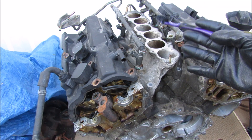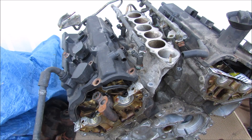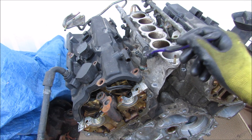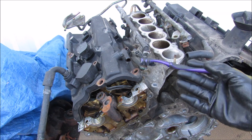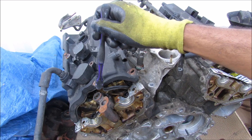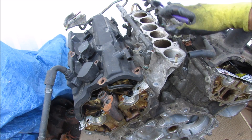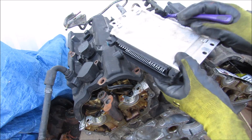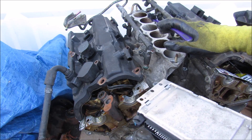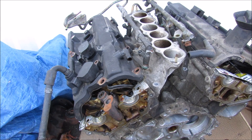That air will go through the air intake system and head into the air intake manifold. The air then makes its way down into the engine head where it combines with fuel from the fuel injectors in a port injected engine. The ignition coil drives the spark plug to create combustion to move the piston down. All of these components in the ignition and fuel system are electronically controlled through the ECU, which takes readings from various sensors to determine when and how combustion occurs.